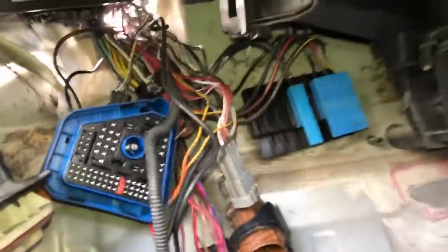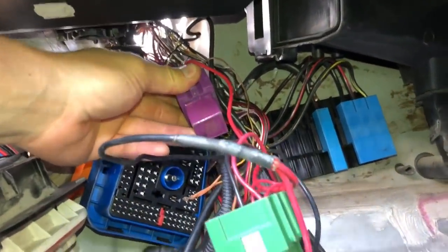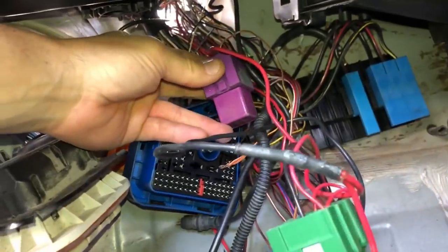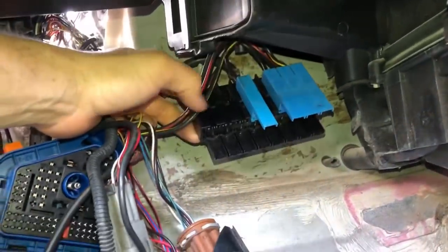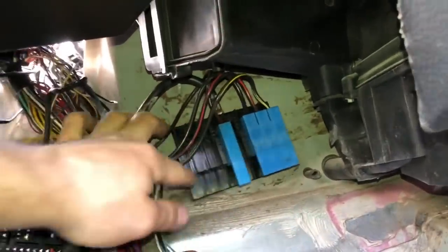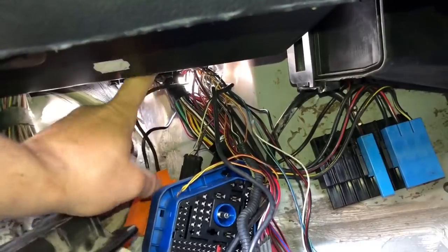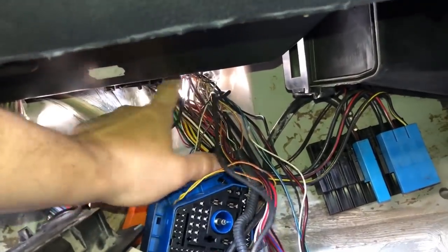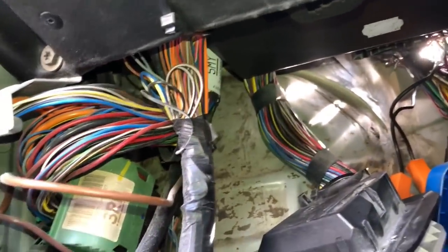It's going to be bolted to this just like it would be on the bulkhead, taped up nicely and attached to a bracket, mounted upside down - similar to OE. The relays were up underneath the dash anyway, and these are for the fuses from outside the engine bay. I'll make a plate to cover this hole and it's going to look nice and tidy.